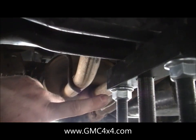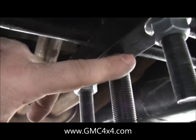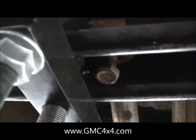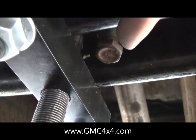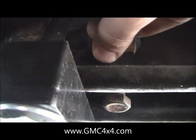So you push this up and then you tighten these nuts as much as you can. And this big bolt here, you want to make sure is inside that dimple on your key. This is your torsion bar adjustment bolt right here. Give this a quarter turn, and that'll take the pressure off of essentially that bolt which runs through this block. Then you want to turn counterclockwise to take this whole adjustment bolt out, and once you complete that, you'll notice that this bar is nice and loose, and then you pull it out, and that will allow the key to become unloaded.